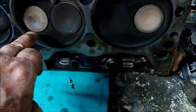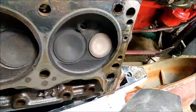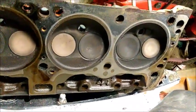I'm going to say that for some reason that one valve is not sealing okay, and that's what was causing the compression issue. I see similar marks on this valve but it's not the same — it's pretty even around the valve. Even the back two are showing they were running a little leaner than what we were getting on that side.